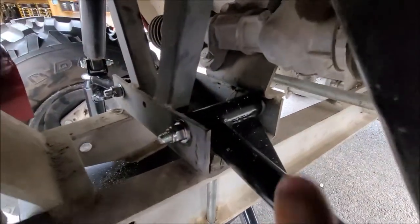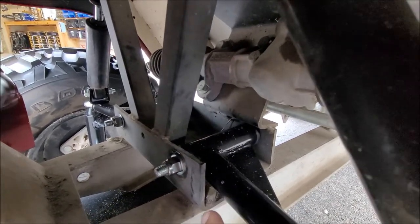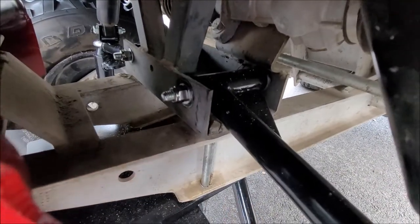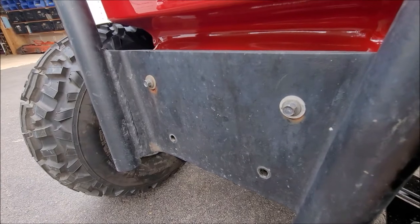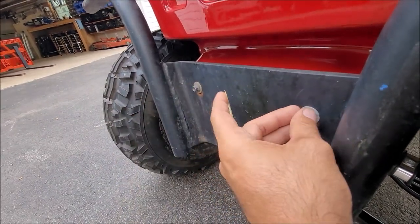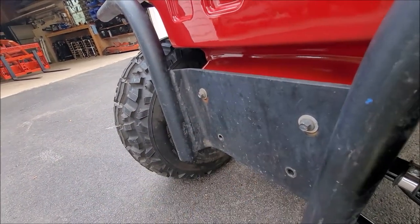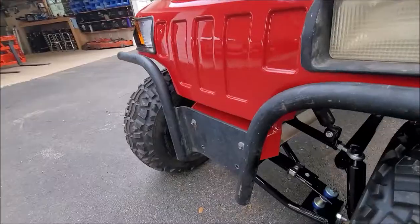When you invert the bolts, the bolt that goes down right underneath your steering box — you want to put that one in first before you get everything tight, because if you put it in last, with the angle you can't get it through all the plates as it's supposed to. With losing the bumper bracket, I just put the 2 bolts in the top that are in the frame, and I think that's going to be good enough because this is a pretty heavy-duty bumper. With the bigger tires, the tires stick out farther anyway, so your tires are going to make the hit first.